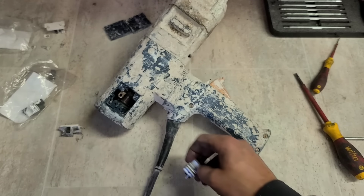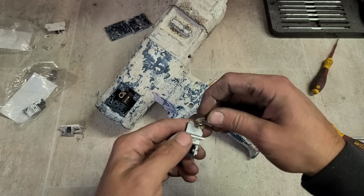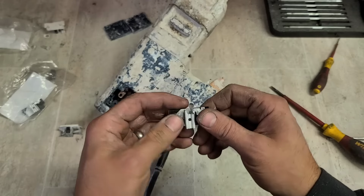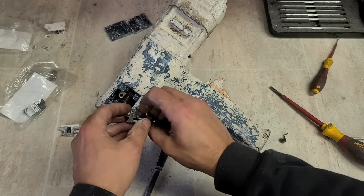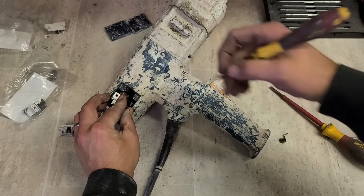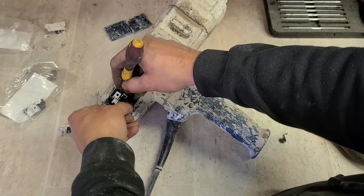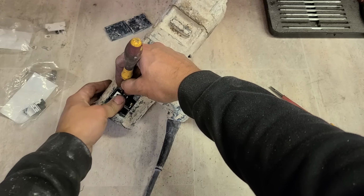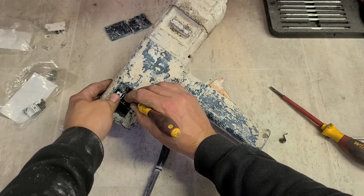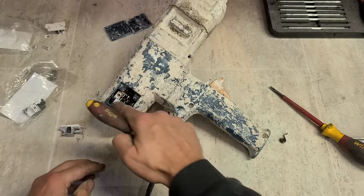We also need brush springs for them. The old ones are going to be a little bit corroded and full of gunk. They mightn't give a very good spring. So when in doubt, it's always best just to replace the brush spring. If you're not getting an even pressure from both brushes, you could end up causing the motor to spark and wear on one side. Just make sure that's your brass tab for your field sitting up top.